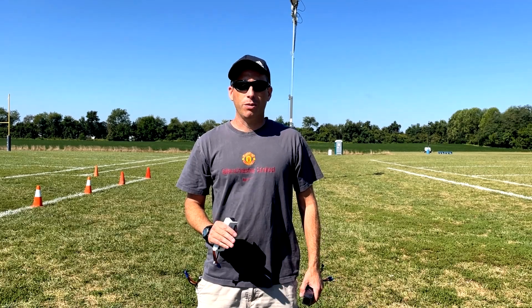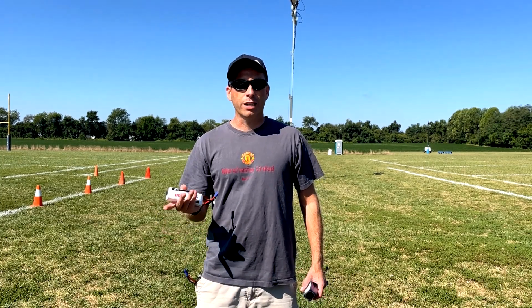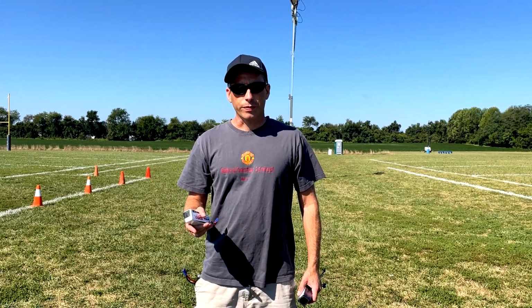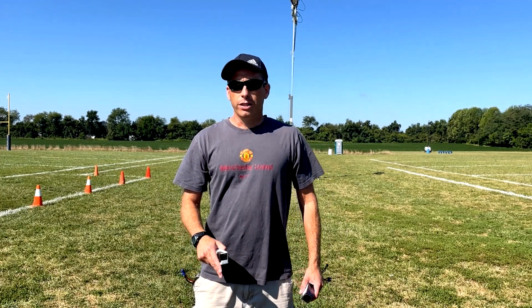However, much of that capacity was not usable in a high demand RC vehicle like my Arma Big Rock. I was only able to get less than half of the total capacity of those four batteries usable in my Arma Big Rock. And the reason for that is the low voltage shutoffs at 3.4 volts. When running it in a high load situation like in grass, there's very significant voltage drop in all four of these batteries. So instead of going down to 3.4 volts and shutting off, the voltage drop is so severe, it shuts off around 3.7 volts.